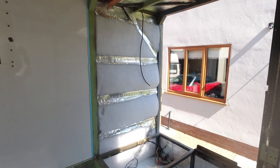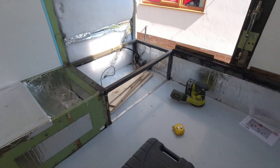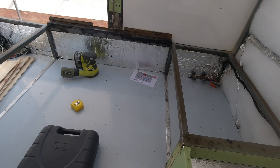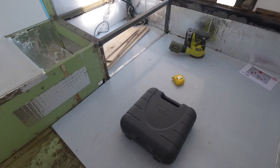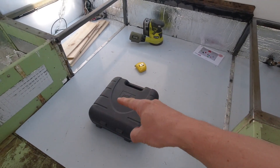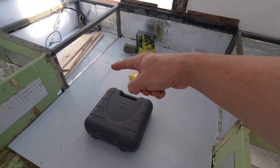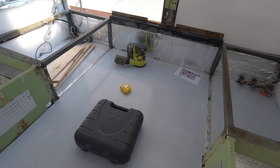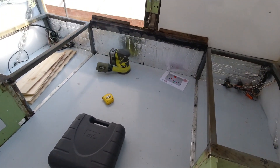As you can see there's the extension. This is actually aluminium sheeting. There was a lot of debate about what was the right thickness to make sure it was sturdy enough to be able to walk on. The rear cross member goes across there, there's a vertical bar on the frame and one that goes across here, so the actual squares in free space are not that large. I went with 3mm and it's really rigid — you can jump up and down, it doesn't make any difference.